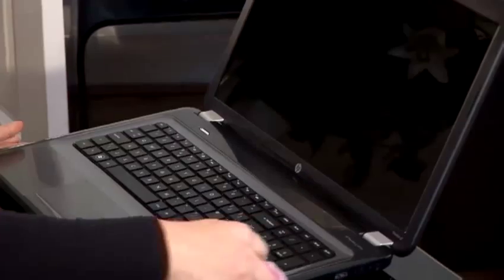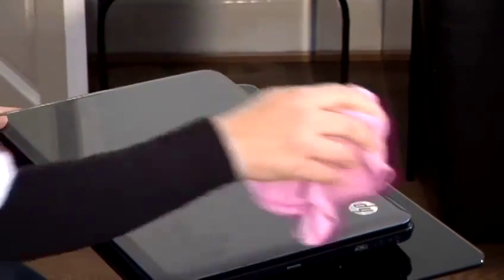Ensuring it doesn't drip. While the computer is turned off and unplugged from the wall, you can vacuum the vent around each fan to pick up those thick layers of dust, then wipe to finish the job.